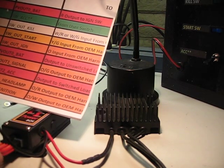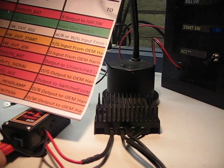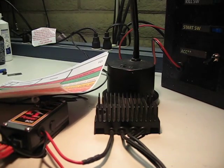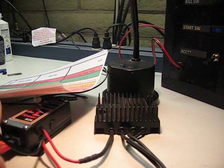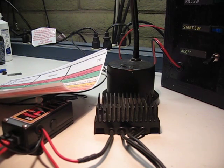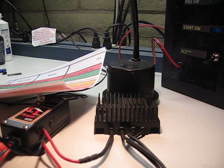red wire, or I'm sorry, an unswitched or a primary red wire, and then the oranges represent the switched outputs, and then the other oddball colors like the white and the red and the green are switched inputs. The only other one is this. One of the reds here is really in fact a switched input, but it matches the red that you have on your harness. That's the primary that was going to your ignition switch.